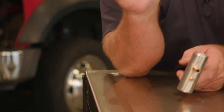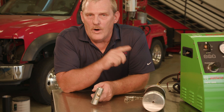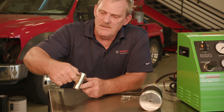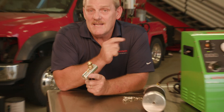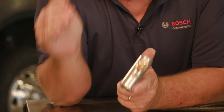Also in the kit is this adapter — it's a block off. Remember there are two bladders in the kit: one for the intake, one for the exhaust. We need to make sure that they both don't flow through, and one is capped off. So we cap off one, and the other will be connected to the HPT500. That's how you get a sealed system.